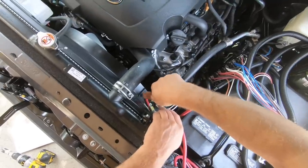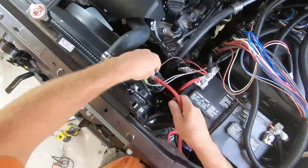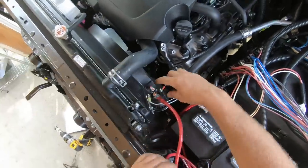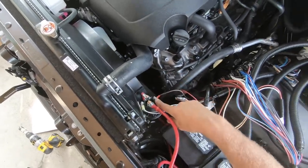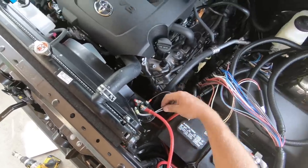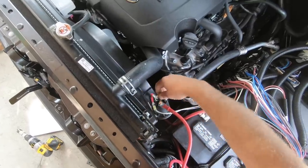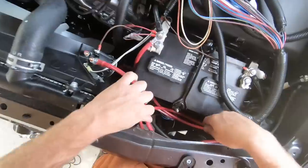One of those red wires is for the dual burn high beams and the other one is for the solenoid. The directions say on your solenoid you don't want it connected to anything that's conductive, so I put it on our fan shroud for our radiator — that's plastic. On one of the smaller screws I got my brown wire, and then I got my two white and black wires on the other one. It doesn't matter which side you put these wires on.